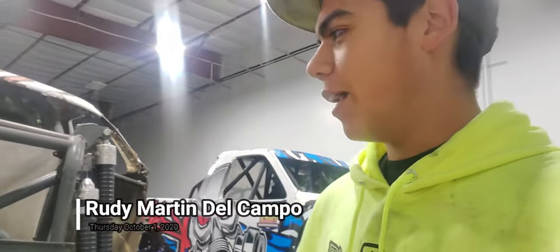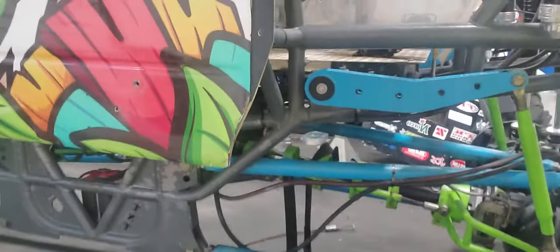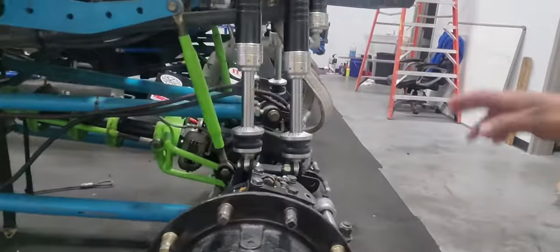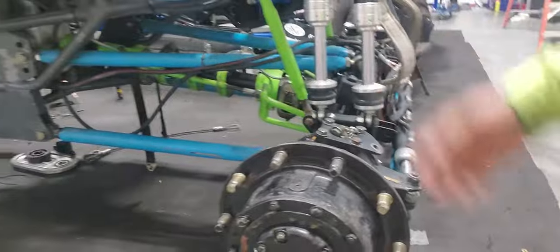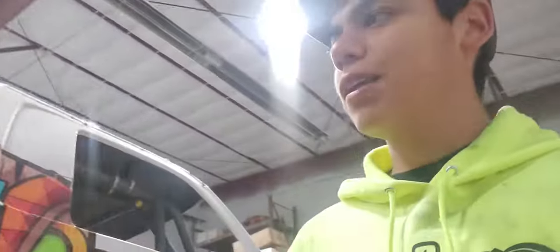I just found out yesterday that I'll be driving Hang Loose, so I got a lot of work to do. The guys put together the front end — we actually blew the front differential last weekend when Bristol was driving it, so we got that all fixed. Now I need to get all the corners, tow the tires back together, fill them up with gear oil, fix the front body mount, and the flex plate has to be taken out because the bolts are wallered out and we'll need to put a new one on.